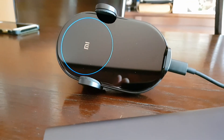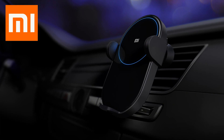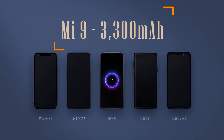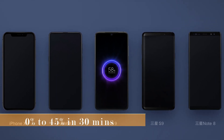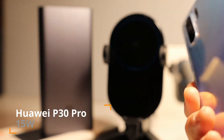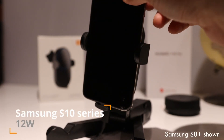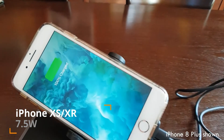Assuming that your smart devices support wireless charging — and ideally wireless fast charging — the new Mi wireless car charger supports up to 20W wireless fast charging. Xiaomi claims it will charge the Mi 9, which has a 3300mAh battery, from 0% to 45% in just half an hour. For comparison, the Huawei P30 Pro charges at 15W wirelessly, the Samsung S10 series at 12W, and the iPhone XS and XR at 7.5W.